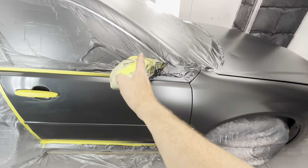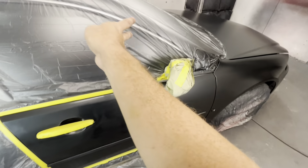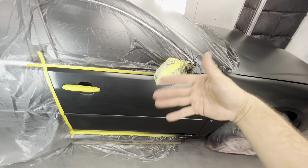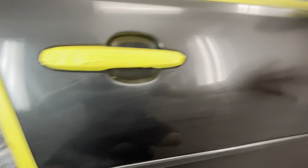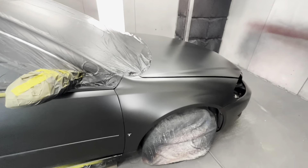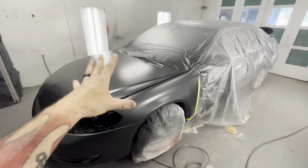I like to stop my blends under my mirrors. That way, when you come to look at the car, that mirror throws a shadow down the door and hopefully helps hide the blend. I just want to double and triple stack tricks to get away with this on every single car. As you can see, we have almost no paint past the mirror — just a little overspray that floated through the air from flicking the gun. I never went past the mirror with the paint gun. These doors will match perfectly. You've all seen when a front bumper doesn't match just because they didn't blend. Let's get some clear coat on this — we're going to shove this thing out and try to get it up for sale today. I'm going to show you what this looks like in the sun untaped.